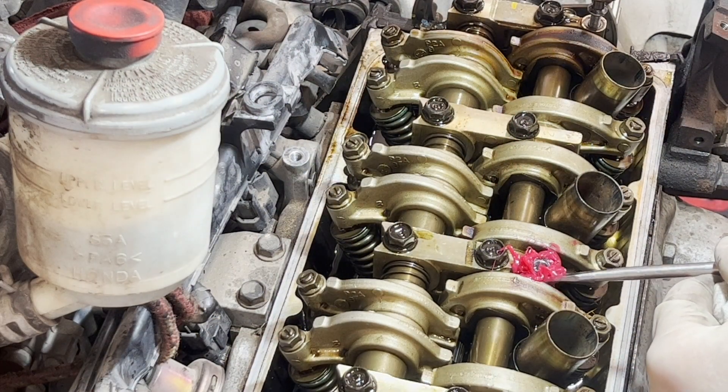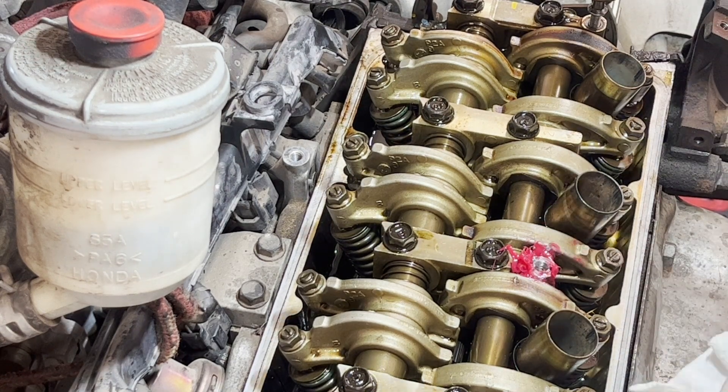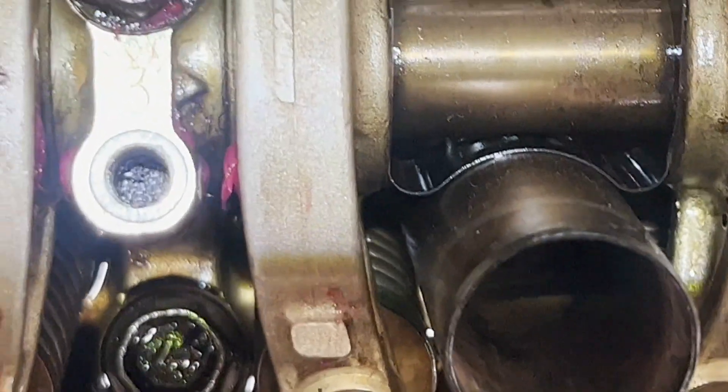You got it tapped. Before you put your helicoil in, get all this crap out of the way. There's a little bit of shavings all the way at the bottom of this — you don't need to worry about that little bit down here. That'll be okay.